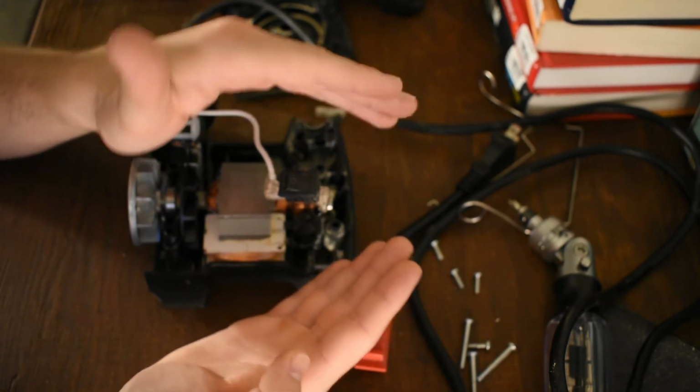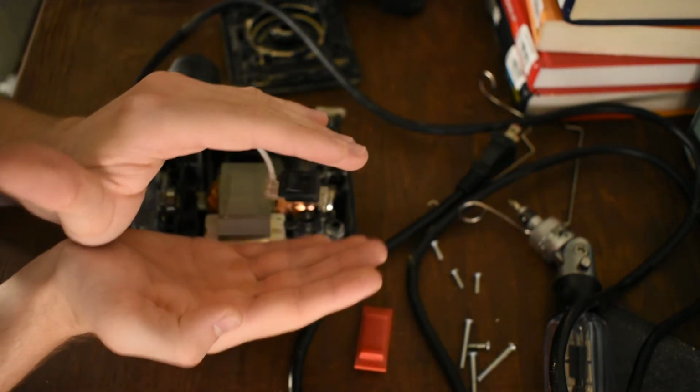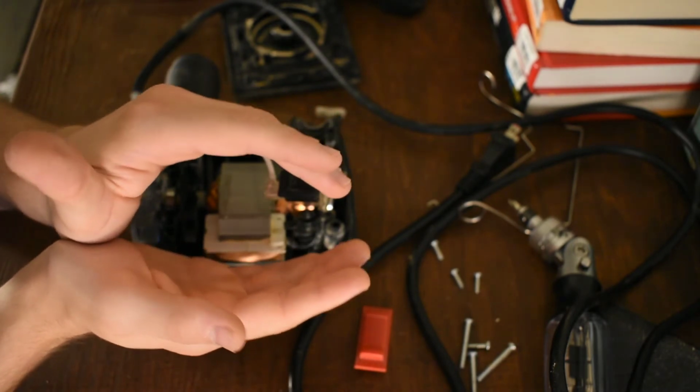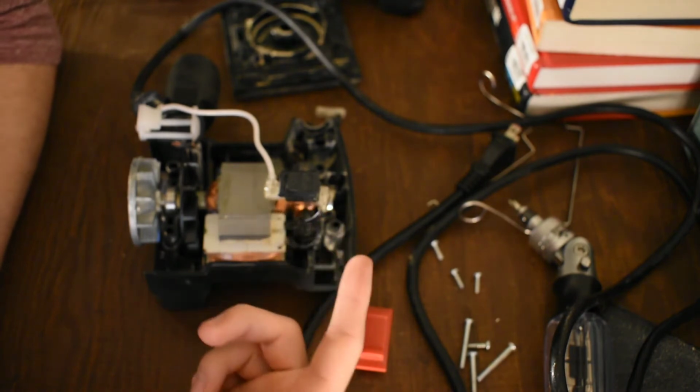So DC is difficult because that never happens. With DC, you need bigger switches because you physically need to achieve a large enough gap to extinguish the arc. And so they're more expensive, and they wear. The wear is harder on them because they've got more arcing and sparking going on inside. So this probably does just fine, honestly.